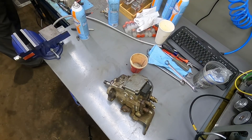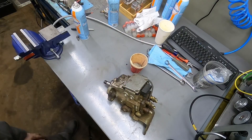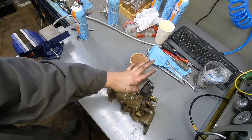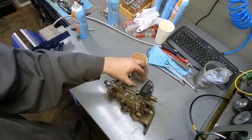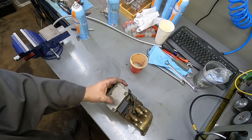The main concern with these ones: you want to make sure you have lots of fuel, good fuel pressure. Get rid of the factory fuel pump, use clean fuel, and make sure you have lots of fuel lubrication.